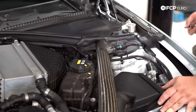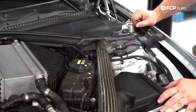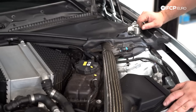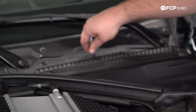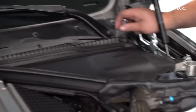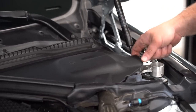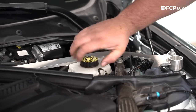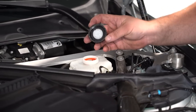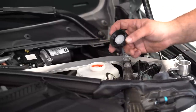We're going to start this brake service underneath the hood. What I'm going to do is check the brake fluid level. I want to make sure that when we push the pistons back in, brake fluid is not going to overflow out the cap and make a mess in the engine bay. We have three 10-millimeter quarter-turn nuts up here. I'll pull the cap back and take a look at the fluid level. We might need to siphon a little bit of brake fluid out — it's a little bit high.